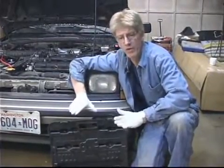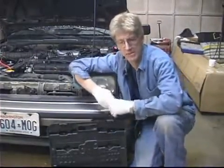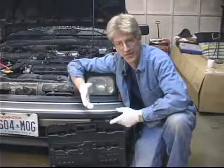But what we don't want to do is mix the 2 chemicals together. We want the antifreeze and the automatic transmission fluid separate. The automatic transmission fluid, I'll just mix in with my oil when I take it down for recycling, and the antifreeze I put in a separate jug and take it down separately.